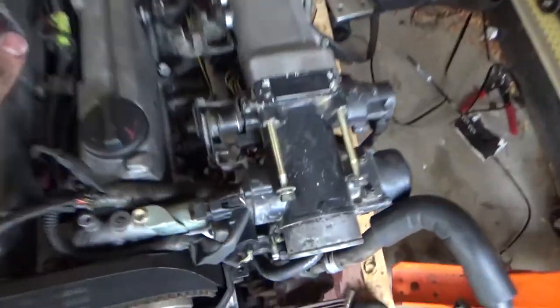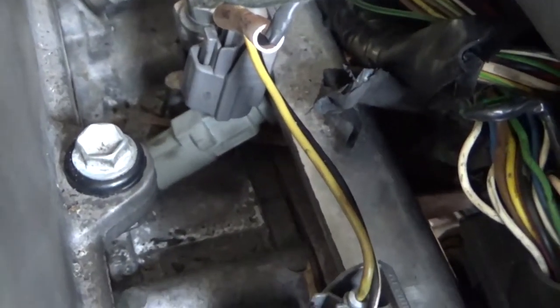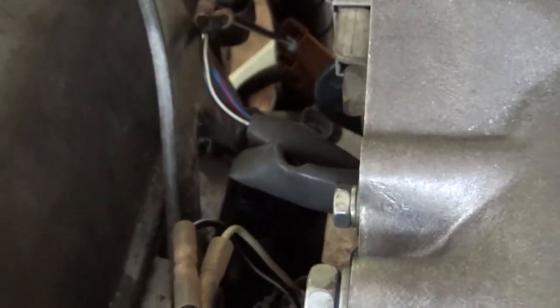So if you're ever doing a JZX110 to a JZX100 swap, you may have to mess with the wiring. I put a JZX100 harness on here, pretty much on the injector clips. Any wire that is black with white trace is a ground — the rest are power, so just keep that in mind.